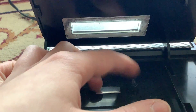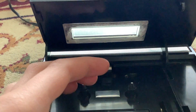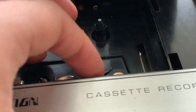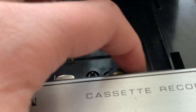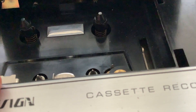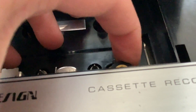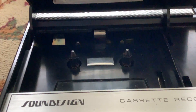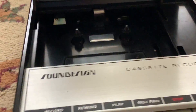I'm going to play it — you can see the head there, it's in pretty good shape. I think the reason I don't use this as a tape recorder is because it's getting old. You can see that the pinch roller is kind of loose, meaning it doesn't make proper contact — I think the springs have worn out over the years. You have to press the play button down a little more firmly. I also think the capacitors need to be replaced, because this is quite old — older than the other unit.